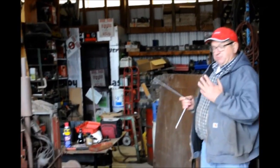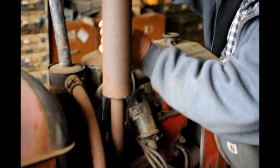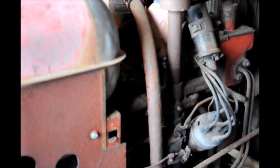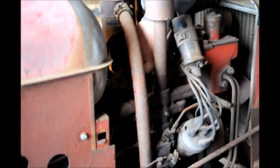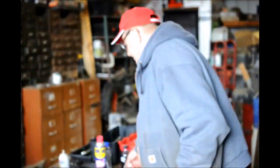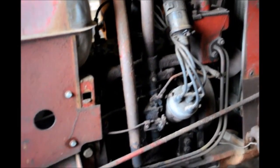So the first thing I have to do is remove the hood to get to the engine. Right now I am in the process of removing the spark plugs and I'm going to place a little bit of oil in each cylinder to lubricate it properly before I even turn it over by hand. Note I said by hand because we do not want to use the starter until we ensure the valves are working properly to avoid bending anything. So this is the first project — I'll get that done and then put new filters in and continue from there.